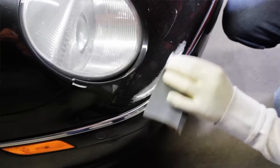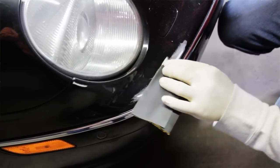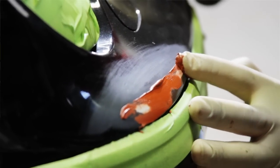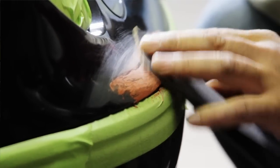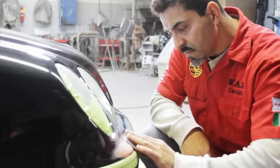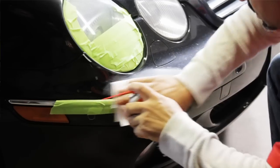In our case it was about a six-inch scratch on a front bumper. We feathered out the scratches, then puttied the area. After puttying, we finished by sanding it down — starting with 400 grit sandpaper on the putty area, then finishing it with 600 grit.